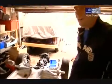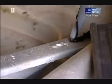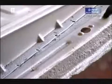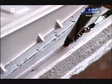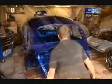Just like you'd have a gasket in an engine to stop the oil getting out, this is to stop the water getting in. To be on the safe side, the lads have decided to use some general-purpose sealant. But they should be avoiding the bolt holes because the sealant will stick to the bolts, making the shell a lot harder to remove in the future. Oh, we'd better have too much than too little. Ready? Yep.